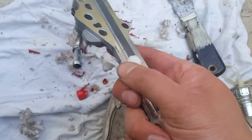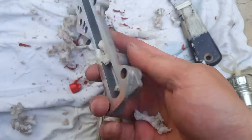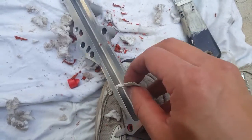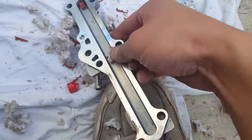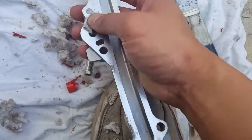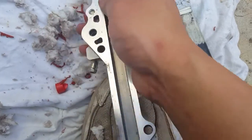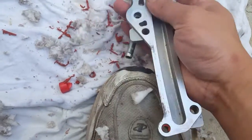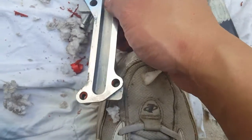It's slow and meticulous, but it's more effective than using sandpaper. This is just a backyard way of doing things, but to me it's a lot simpler than having to use sandpaper and potentially scratch up the mating surface — I really don't want to do that. So again: melamine sponge, nice and slow. Just make sure you blow off all the debris before you install everything back.